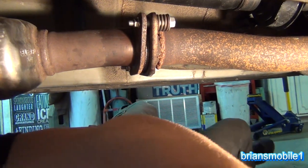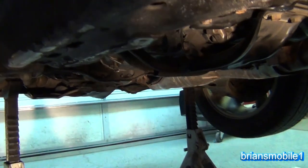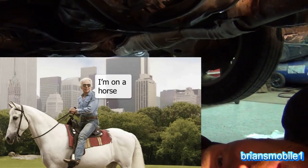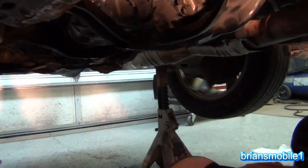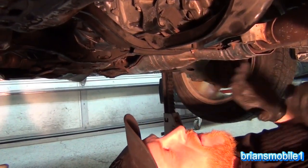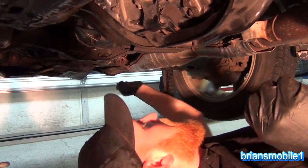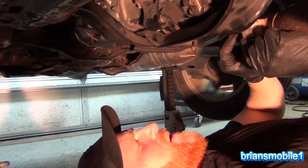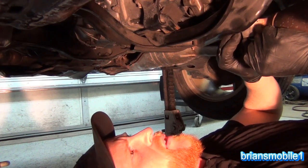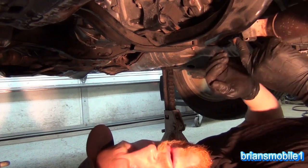With the front I put it together the same way — using a jack stand and a tripod. From motorcycle exhaust experience, you always want to start at the engine and work your way back because it's fickle and picky. I do the same thing here — start at the front, work your way back. With this hanger I needed a little bit of play to position it and make it happy. With this hanger in place the other one over here isn't going to move around quite so much.